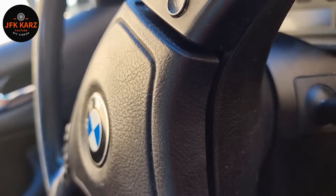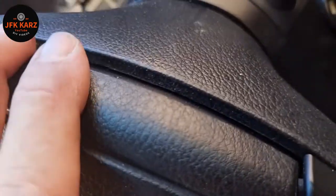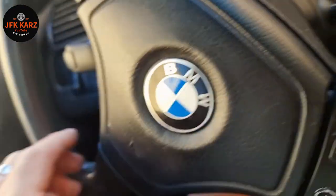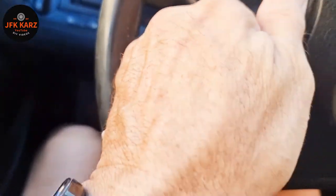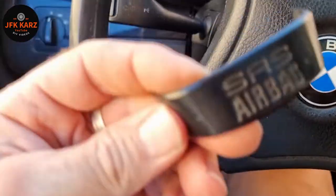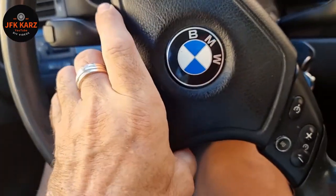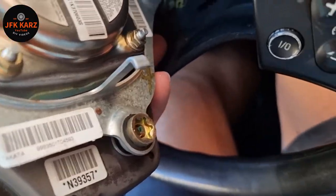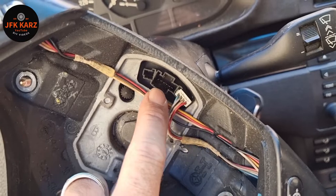So I'll just do the other screw and that will release the airbag. The two screws don't actually come out — they just sort of push the airbag out. Now I'm just wriggling to try and get it out. It seems to be stuck down this end more so. I've just removed that, may help a little bit. Just a case of jiggling. And it gives you access to release the plugs — this one was in here, so I just pulled that out.